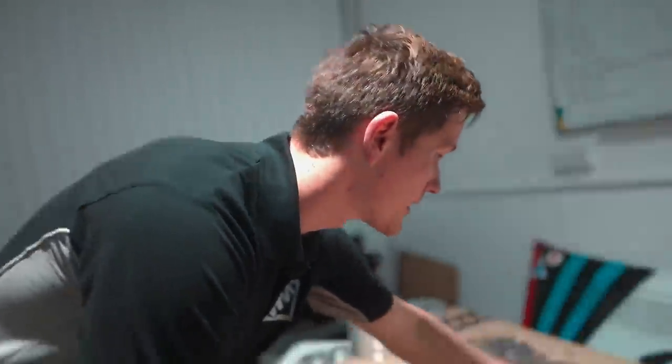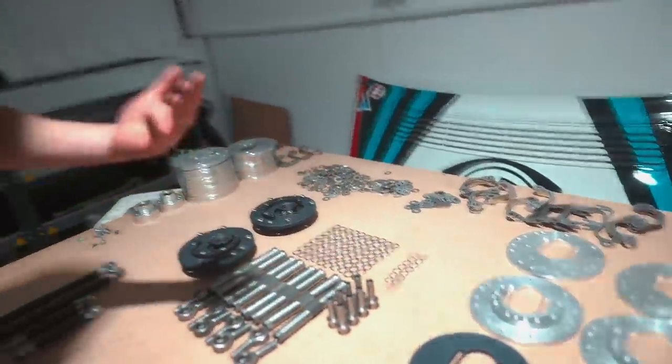So you can't adjust the camber on a stock 720? No, you've got to use shims, yeah, exactly. Right. And you bolt these on all four corners, yeah? Yeah, exactly. Different thicknesses at the rear and the front depending on what we're doing it for. Because the biggest issue with the McLarens, when you push them hard, is they murder the outside edge of the tyre. Right. And that's why a lot of McLaren owners on track are down to cords sometimes on the outer edge, especially on the fronts, because they don't have enough camber as standard for that aggression, because they're designed and ultimately sold for road use.